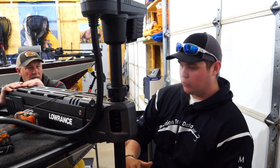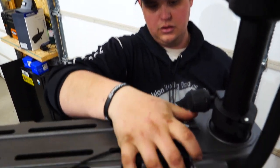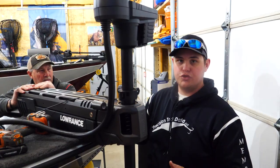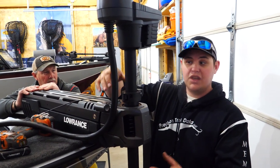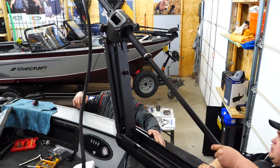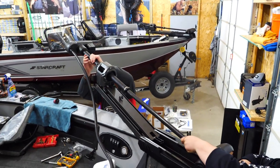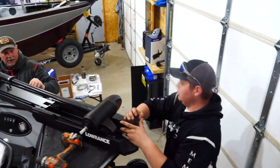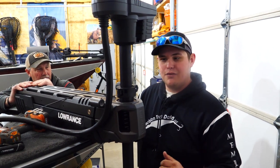What I'm going to do is fold this whole system up loosely, position it how I want it, and then mark the holes to drill. Before I drill the holes I'll pull everything back down, undo these two bolts, pull this back off, bolt the scissor bracket on, and then this comes back on again. It's a little bit of an extra step, but you want to do it to make sure everything is aligned exactly how you want it — because once you through-bolt it, it's there forever.